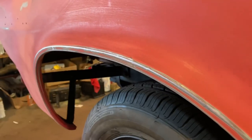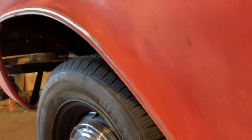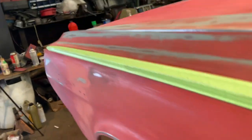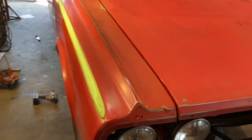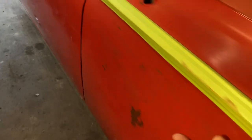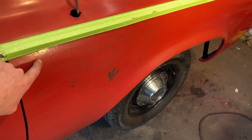You can see some of these little chips. I like to sand until those are gone. I had to take this down to bare metal because it had — see right there — little tiny rough spots. They've got to go. So they'll be gone. I can prime this side shortly, maybe today, get my whole section primed. I don't like to walk away and leave it in bare metal for more than a day or two. So this side over here is going to need a lot of love, so I may just wait to prime that down.